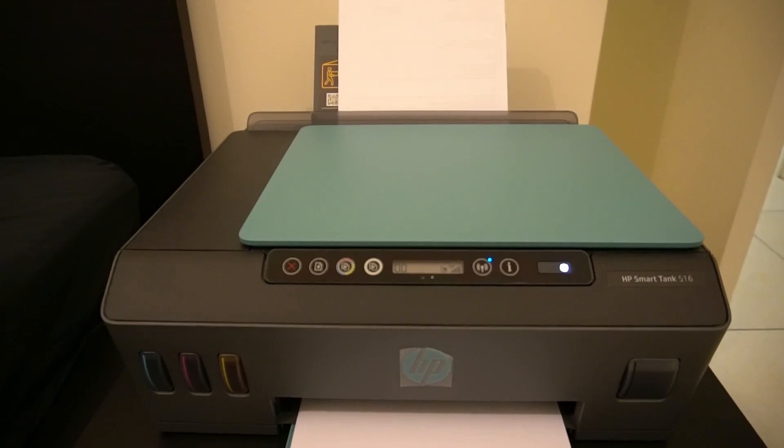So what I've done in my Microsoft Word document is selected a size of legal at the time of printing. Legal is much longer than A4. Here in the UAE, and most parts of the world, you have A4; in the US you have US letter. If you don't select the paper size to match your paper in the printer, it detects that the page has not ended — and that's why you get this E2 error.